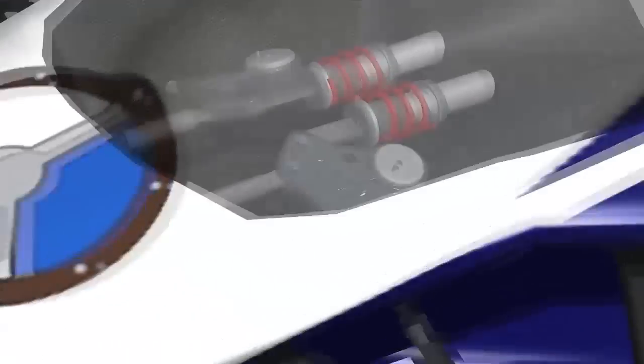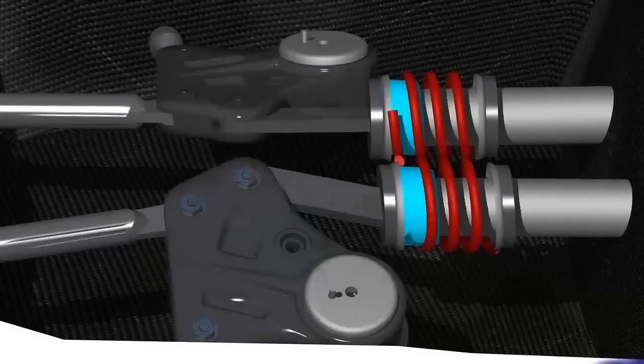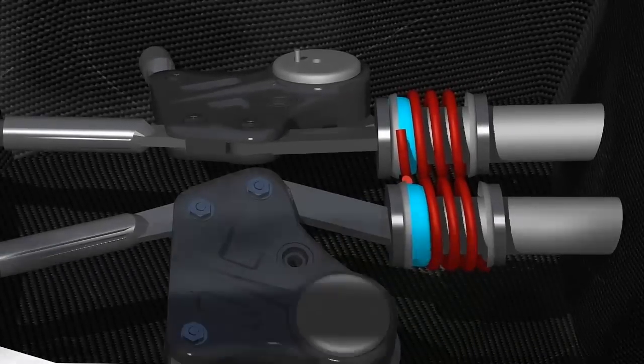There's one other element in fine-tuning your suspension: the bump rubber. Bump rubbers are an invention that allows us to run softer springs and lower ride heights without crashing into the ground. As you get down near the ground, the bump rubber comes in and adds spring rate right at the end of travel before you hit the ground. They protect the dampers and the car from crashing metal-to-metal if the suspension runs out of travel. They also allow a variable-rate spring in the system, letting you run the ride height a little lower without stiffening the springs, because the bump rubber will catch the car just before it crashes into the ground.